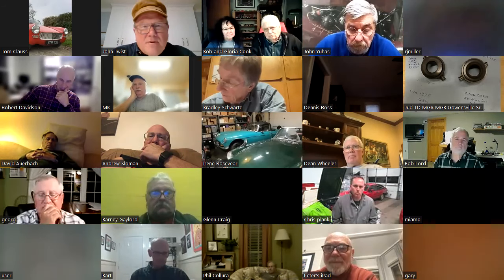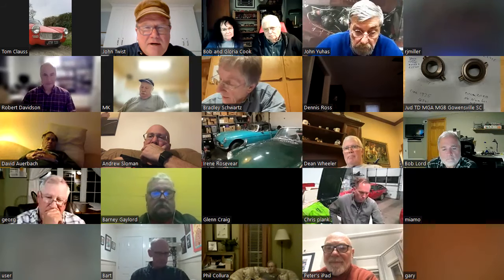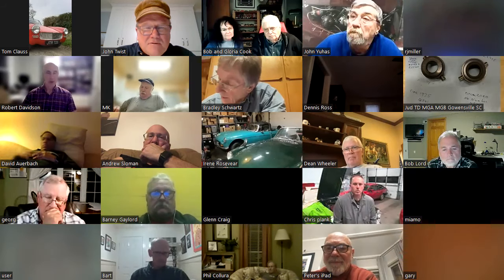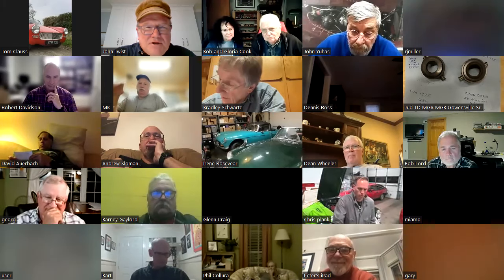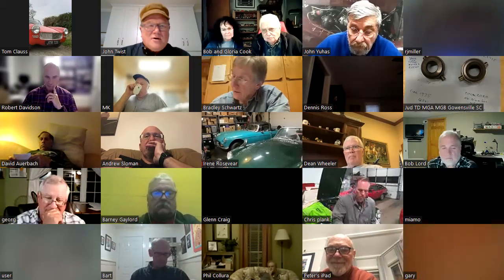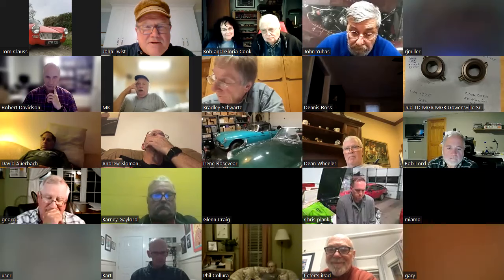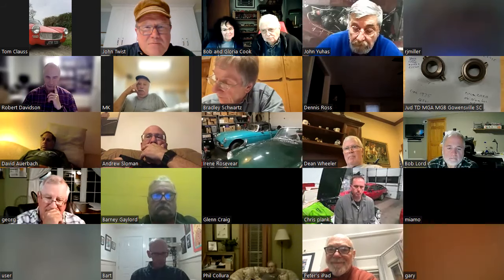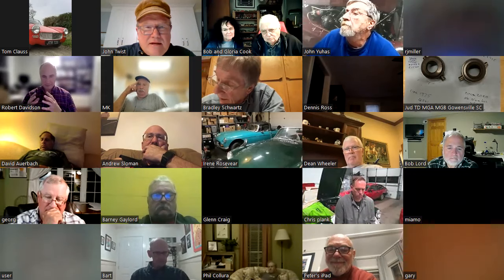So the other problem with the clutch is you get a juddery clutch. You know, you're trying to back up, you're trying to be cool and show somebody that you've owned this car for 13 years and you know how to back up, but it's just rant, rant, rant, rant. It's just awful. And almost always that is from the springs being bad in the clutch itself. And there's no hope until you take the engine out and replace the clutch.